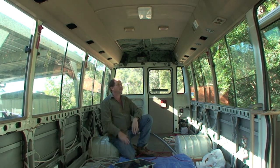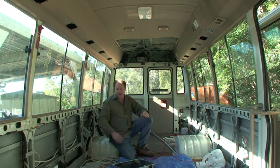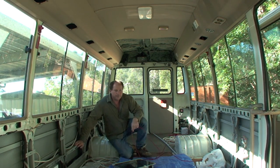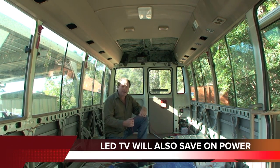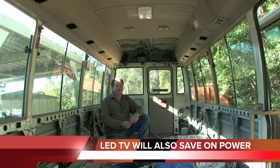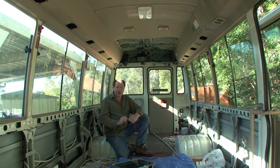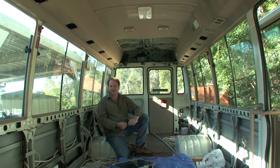That's the 12 volt for the lights, and it will also run my 12 volt water pump, my 12 volt TV, and if I want to I can use the 12 volt on my three-way fridge as well. That'll all be running off the 24 to 12 volt charger. The particular one I'm using is outputting 20 amps, so it's got some grunt, which is good.